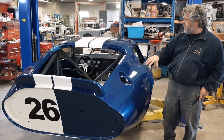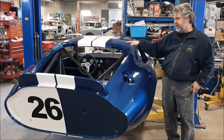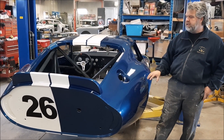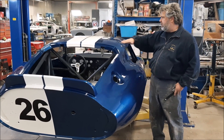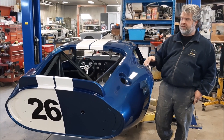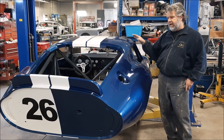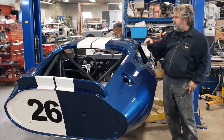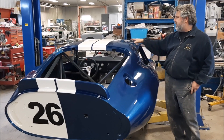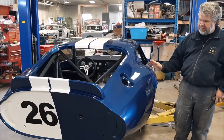After they had three coats, they did a little bit of wet sanding, then they applied two more coats of clear. This is out of the gun after the last two coats of clear, so we haven't done any wet sanding or polishing yet. When they go to do the final wet sanding and polishing, when you run your hand across, you're definitely not going to feel any of the lines, not even the black number 26, after they do the final polishing. You have three coats of clear, and once they wet sand it you lose about a half a coat of clear. Then when they add two more coats of clear, that gives it more protection and a little more shine and depth. After the final wet sanding and polishing, you won't feel any lines whatsoever, and there's lots of clear left for polishing later on.